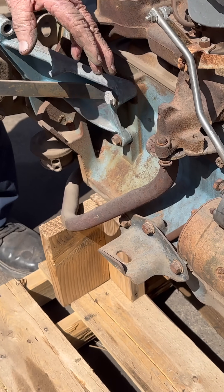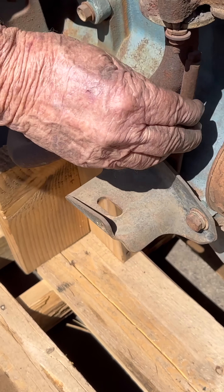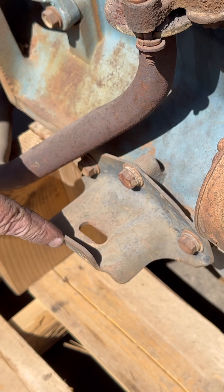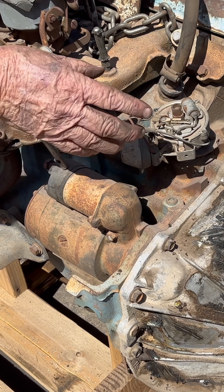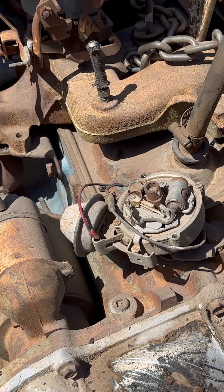The starter is kind of complicated. The motor mounts — we look at these a little bit. The starter is a weird starter that bolts up here close to the flywheel. The distributor is in the back, like a V8 would be. Of course, it's only a four-cylinder distributor.